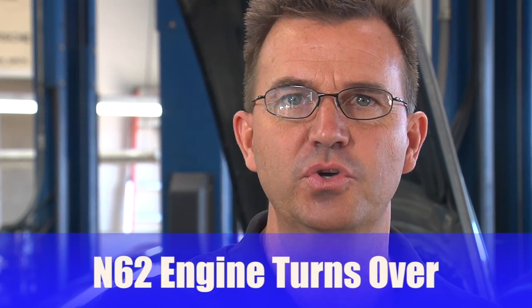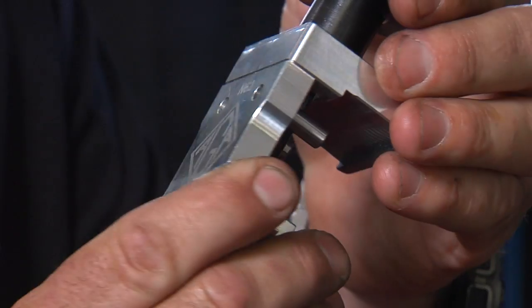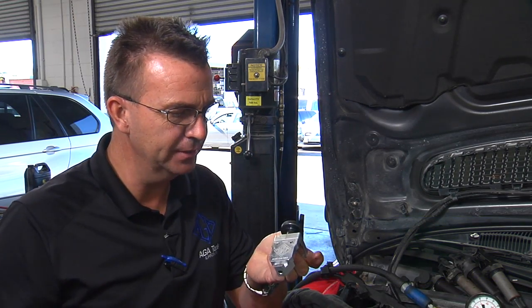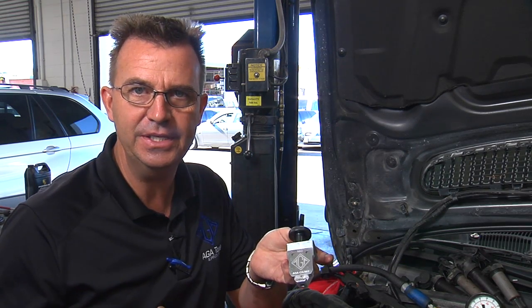The problem is the engine turning over when doing valve stem seals on an N62 engine. Here we have the N62 chain lock to prevent this problem. We always try to improve on the procedures. In this case we've gotten a lot of feedback from techs in the field that they've had issues with the engine turning over when placing on TDC. This chain holder prevents that from happening.